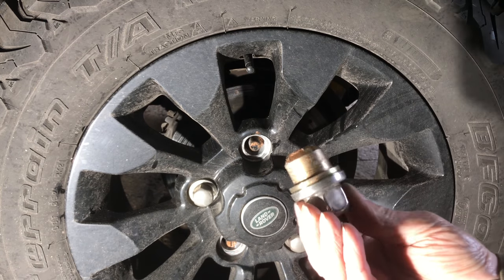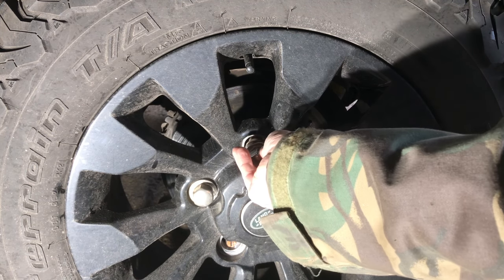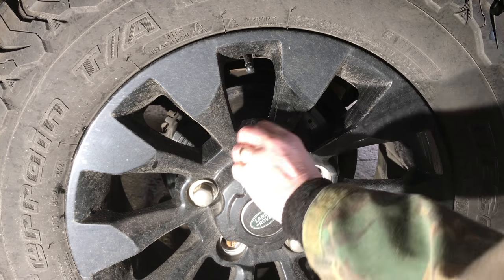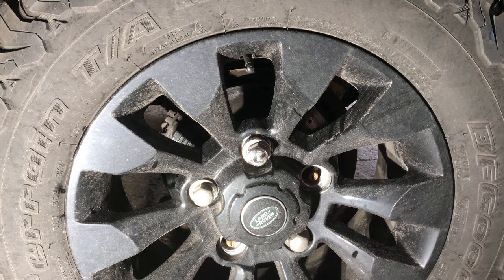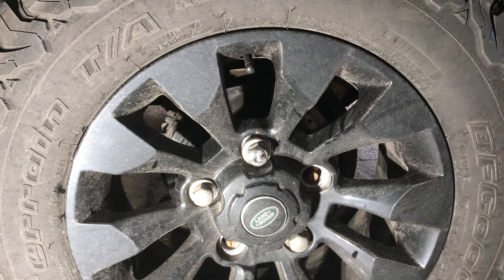Okay, that's the style of the nut — it's got quite a thick sleeve on there that fits in the recess in the wheel, and it does up very nicely once I get the thread started. That locks in great, but I find I'm struggling to get the wheel back on because I can't hold the wheel exactly in the right place to have equal distance around the stud to get the nut through the recess. Hence the reason I've made the jig. We'll zoom out, look at the jig in place, I'll take the wheel off, rotate it, put it back on, and hopefully have very little trouble.